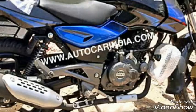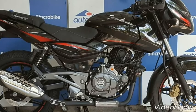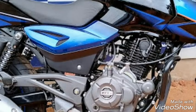Classic 150 front disc is 240mm, back is drum brake. Ground clearance is 165mm, same as UG5. Seat height is 785mm, same. Full tank is 15 liters, same. Reserve is 3.2 liters. City mileage is around 65 kmpl, highway around 58 to 59 kmpl. 0 to 60 in 6 seconds, and 0 to 100 in about 17 seconds.